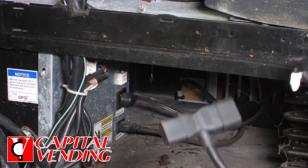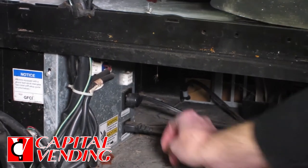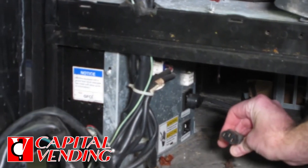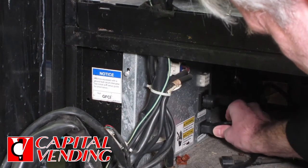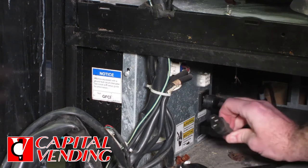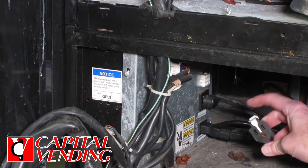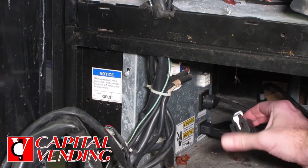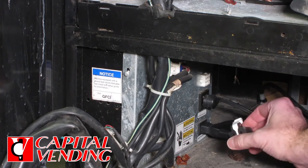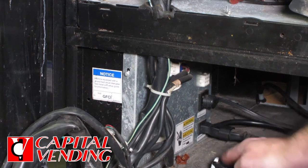This is the easiest one to install. If you have newer vending machines, this is recommended. All that you're going to do is unplug this power cord from the junction box, then connect this cord — it slides in easy. Then the original cord from the wall outlet plugs into this adapter. Now you have this female 3-position outlet, and the cord from our timer kit that controls the temperature will plug in here. The bulb is mounted up here, making for a very quick on-location installation.